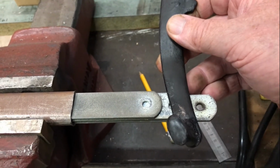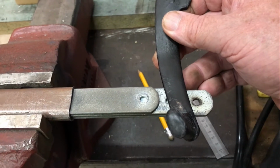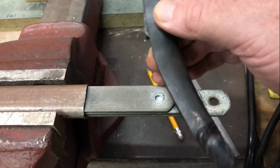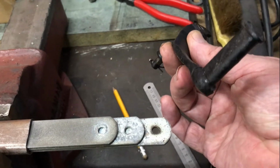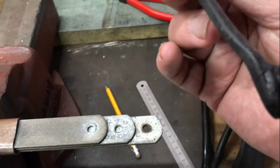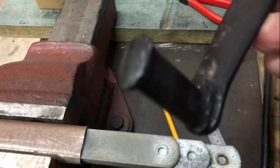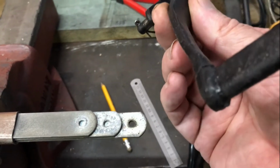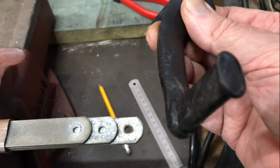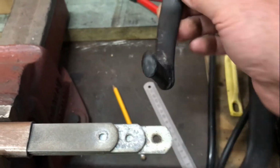I'm going to mark out some pieces and create effectively a slot between these three pieces, and the pedal itself is a bit over 3mm wide. It's got a kink in the middle of it as a stiffener. So being wider than 3mm, a bolt through there will clamp onto it pretty well. So let me go ahead and have a go at that.